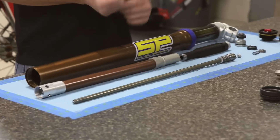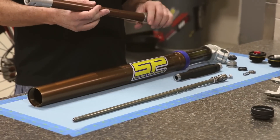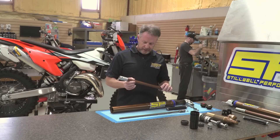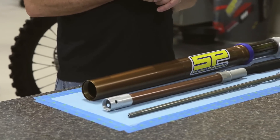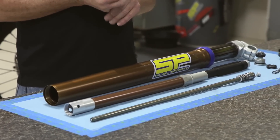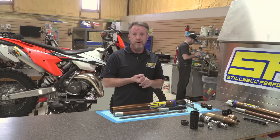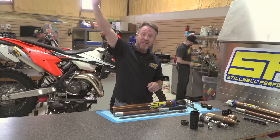Paired with all of our valving, this is really a world-class setup. We also do that to your damping rod tubes, because you have a rod that moves on a bushing up in here, and we found that the coatings will help with smoothness there as well. I've looked around in the competitive marketplace and I'm seeing things being built and changed in here that honestly you really don't need. We're very cost-competitive on our solution and we hope you check us out. So whatever you ride and wherever you ride — get out there and keep it pinned.